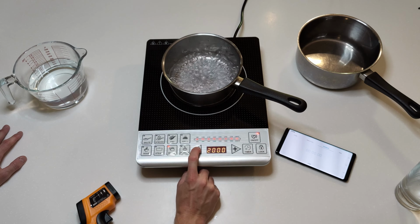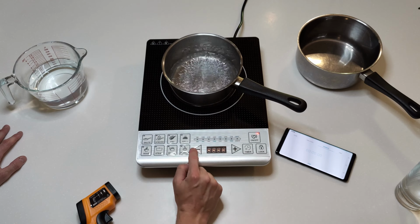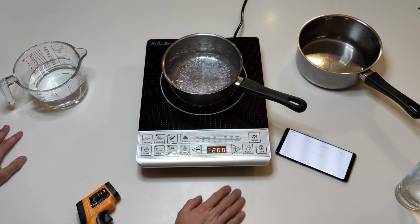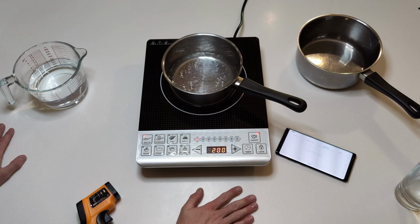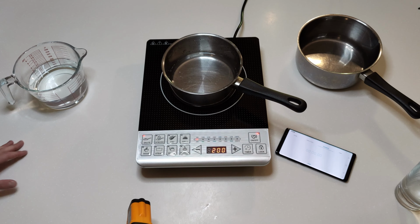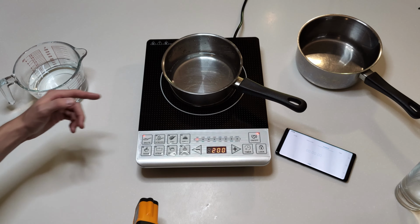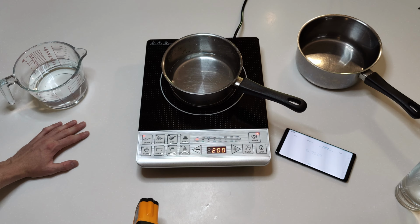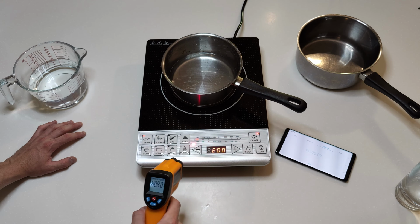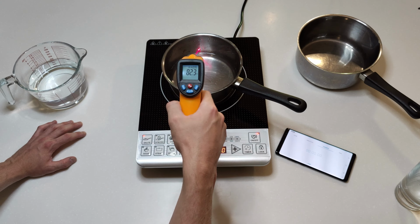So theoretically, if we, how do I, alright, so there. So that should be 200 watts, 80 degrees. Now I wish I had my little doohickey here that would actually show me the temperature, the power consumption, but that's in use in the other room at the moment. This is pulsing on and off, which is getting a little bubble out of it every time it pulses. I'm assuming it's got a thermostat in there. Digital or analog, don't know, it could be a bimetal strip. I'd assume, given all these controls, that it's got something digital in there. So it's 82, 83. Just keeping around that mark.